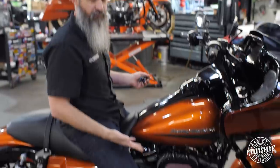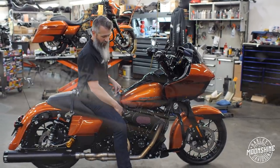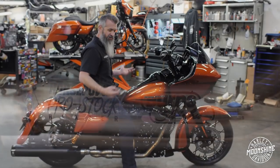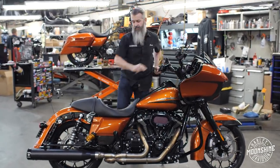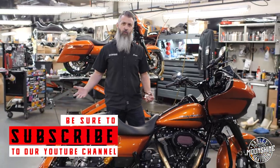Power plant — we like the 128s, we like our 131, we like our 135. This one right here is a 128. We have a 550 cam in there with our plus 1.5 millimeter overheads — 147 horsepower, 148 foot-pounds of torque — and it's got our exhaust system on it. It is the ProStock header with the ProStock mufflers. This is the system for the guy who has two cutouts in the back of the bags and wants to fill them. Another reason we go to this system is if you don't want something over the top loud — you don't want to get off the bike after a five-hour ride and hear it for 10 more hours. This system barks when you're on it, but when you're cruising it's nice, low, good tone. Really, really nice setup, and it does fill the bag holes in very well.